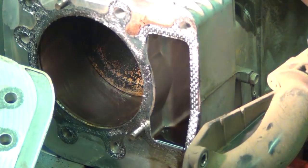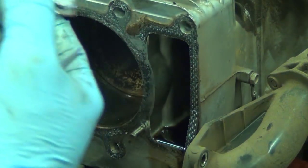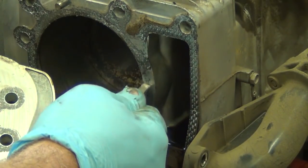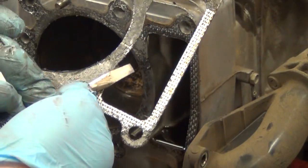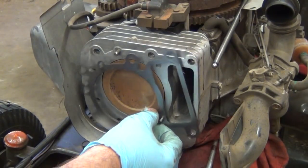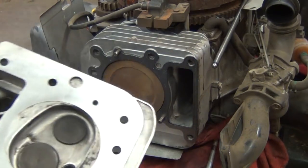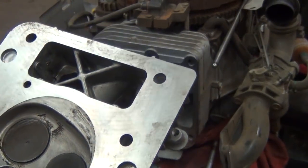I'm going to pull it all off and get it cleaned up. I bring the piston to top dead center and use some carb cleaner to melt the grime off the piston, and a soft stainless brush to clean it up. Make sure the piston is at the top of the cylinder so you don't scratch the cylinder or get debris down in those rings and cause them to bind. I do the same with the cylinder head. Blow out all the cylinder head bolt threads, and I throw a little WD-40 on all the bolts when I put them back in so they thread in smoothly and you get proper torque.